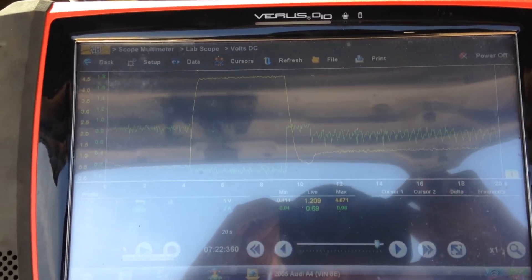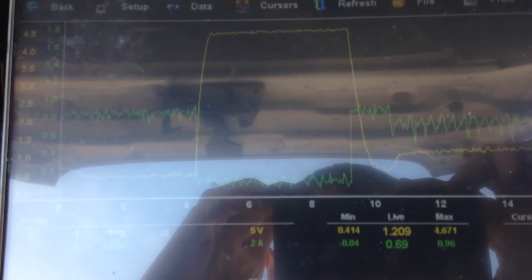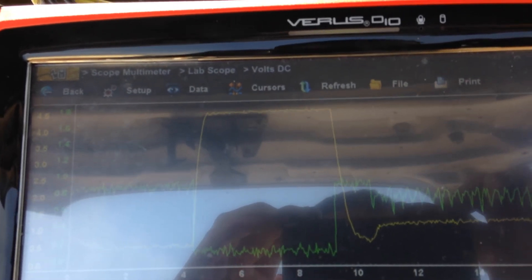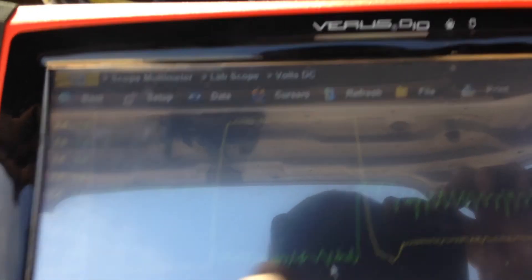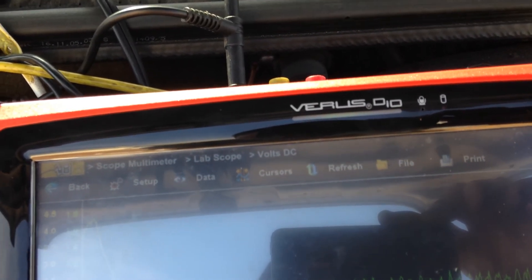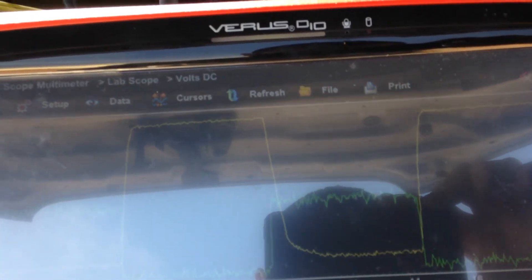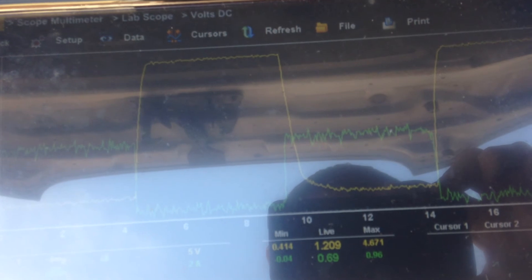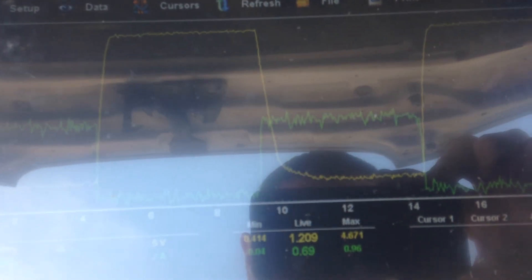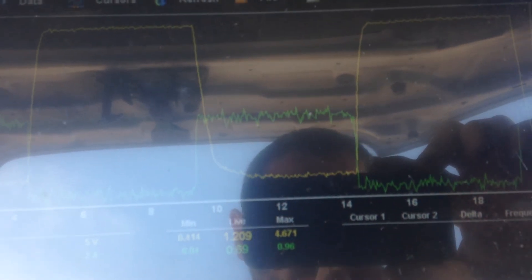So this is a very good indication that our circuit is working correctly. We see when there is no current flow in the circuit it is able to dump the vacuum quickly and we have a high voltage. And at the point where the current flow is higher, we see that the vacuum is applied to the waste gate in a controlled manner and quite quickly. I hope this has been an informative tutorial for you. Thank you.